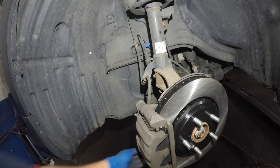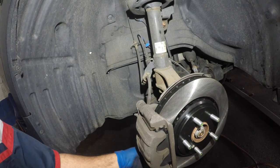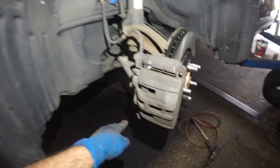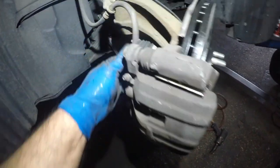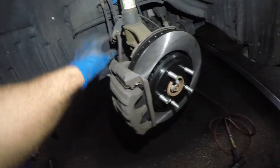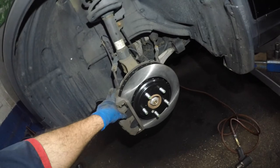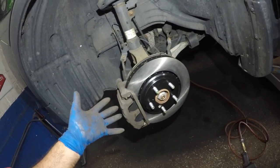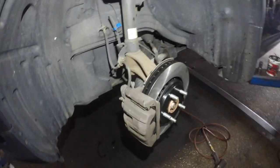Once you've completed the whole job, make sure you pump the brake pedal before you start the vehicle. Also make sure this bolt is tight — you won't see me do it, but make sure it's tight. Make sure your brake line is nice and straight — I've seen people leave it bent and twisted, which causes restriction. Thank you for watching — there you have it, a well-done job. Put a little bit of grease in here if you want to.